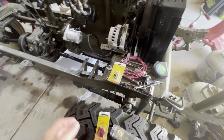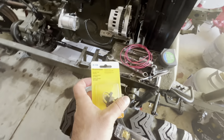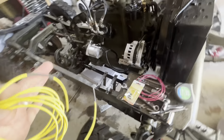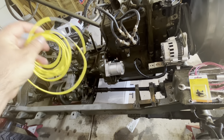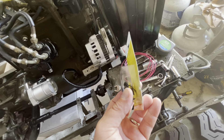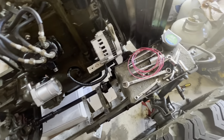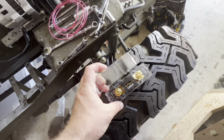I did buy 10 amp fuses. I'm going to wire a 10 amp fuse into the wire that comes off the alternator - this wire right here. This plugs into the back of the alternator, runs to your voltmeter and your ignition switch. I'll show you how that works once we get the wiring all set up on the key switch. I just bought a basic inline fuse block with 10 amp fuses.